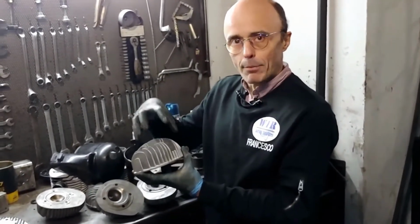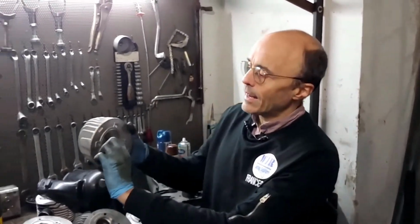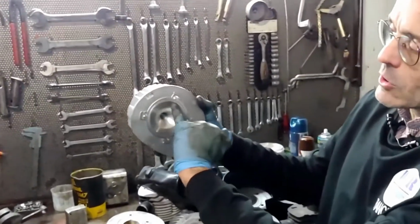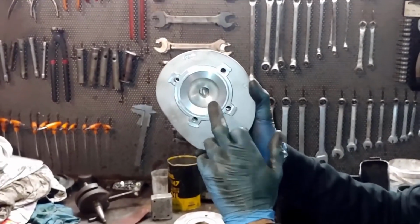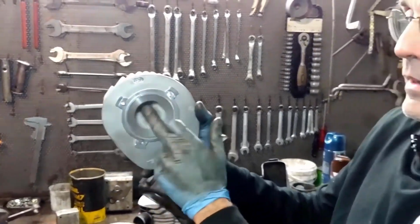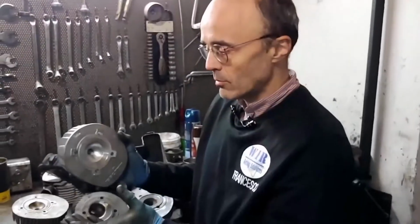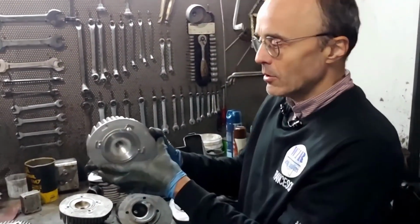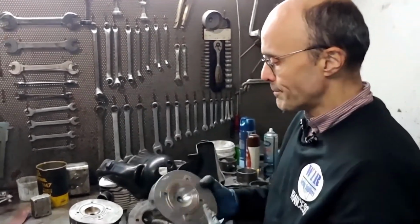For what reason? Because the part that rests in particular is the periphery, so the fins are exploited more to cool the circular crown, essentially the squish area, which is the one where, especially in the part towards the exhaust, you can determine the self-ignition, which never occurs in the center of the chamber, because it's the point where the turbulence is most effective and is the best washed part also. This is the reason. And that is why the support is on the side.